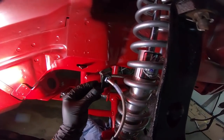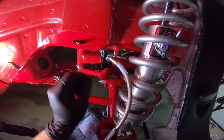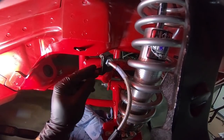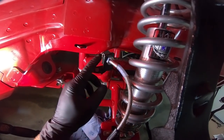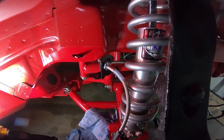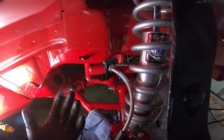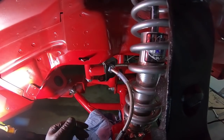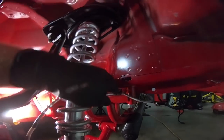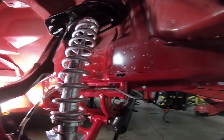I think I've got it where I'm going to set it. The only thing I might change is I might put a spacer between the mount on the K-member and this piece that holds the brake line in place, just to bring it down a quarter inch or so. I don't think I have to, but I just don't like it riding up against the body of the car. That's not technically going to be moving, so it shouldn't be a big deal, but it would make me feel better. Other than that, I think we can go ahead and zip tie these lines and start working towards the center.